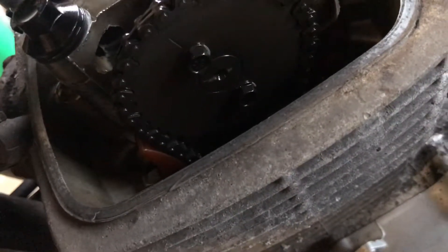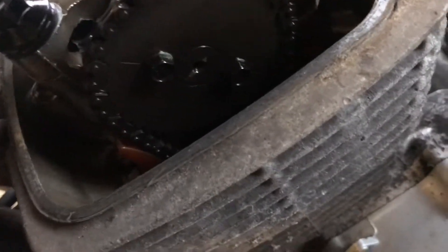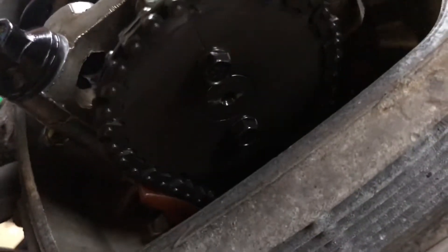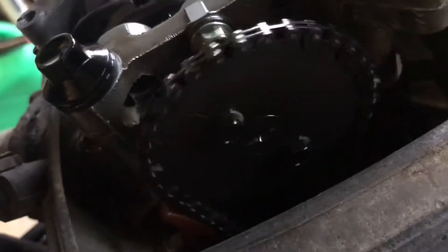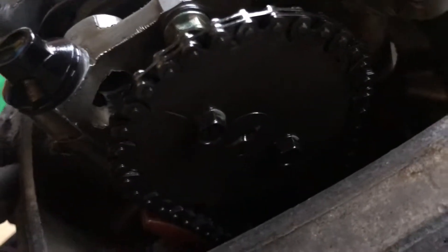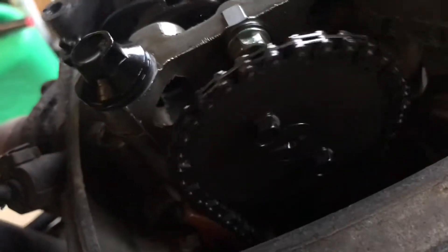There's definitely contact there. Something's definitely getting stuck and it can't turn the other way. If I rattle it around, you can hear that looseness — there's metal-to-metal contact going on inside. In all honesty, it feels like the conrod has come off the piston. It's completely locked and I can't turn it, so it's a good thing I'm not trying to start it yet.